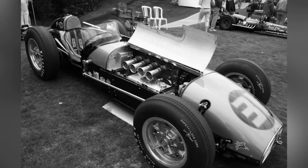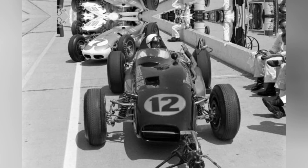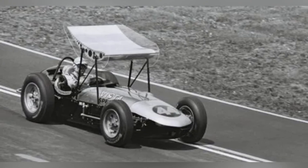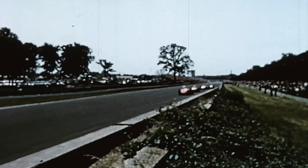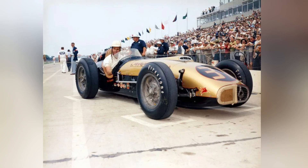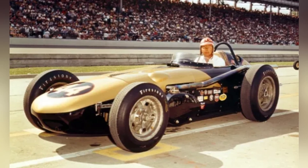The reverse torque special's design philosophy emphasised stability. A stable drivetrain helps the driver feel what the car is doing and react faster. In traditional setups, when a car accelerates out of a left-hand turn, torque naturally loads the outside rear tyre, causing the inside tyre to lift slightly and creating uneven traction. The result is a repeating cycle of oversteer and correction — what racers call a feedback loop. Drivers have to constantly modulate throttle to avoid spinning the car, especially during corner exit. That constant balancing act costs valuable fractions of a second per lap.